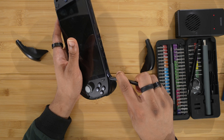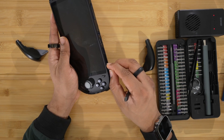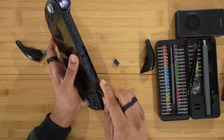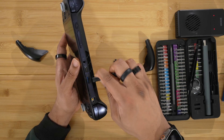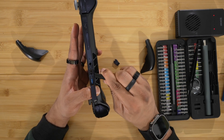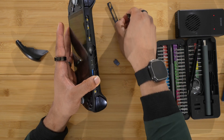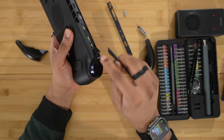Get a pry tool, pop that top plastic piece up carefully and it will start to come out. Pry it up a little more, then pull it out — no broken clips, that's good. Now pry up the other plastic piece along the entire length of the device. Be careful not to force it. The buttons will fall out when you lift it — don't worry, they just go back in like little blocks. Get the other side and pry that up as well.